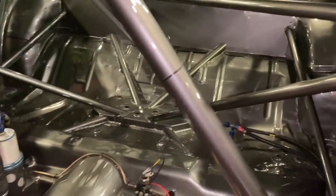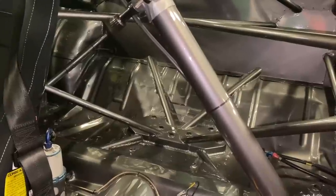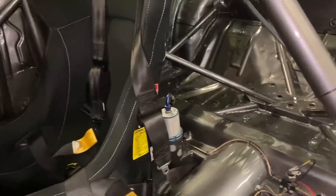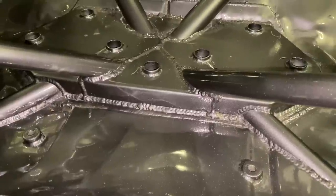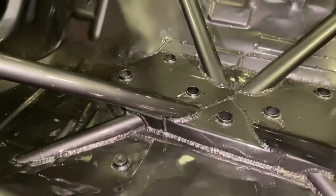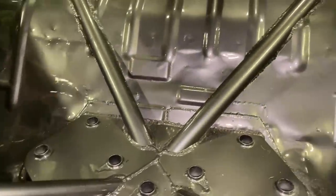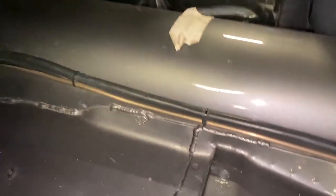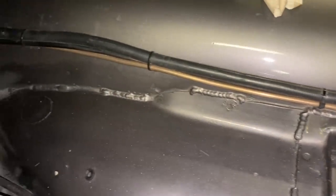What I do find interesting — the tubing is very thin, there's a lot of it, looks like probably 20mm tube. An interesting one that's come up in a lot of conversations recently: if you look, this is a genuine touring car, Vauxhall factory-built. And all the welds are spot welds — spot, spot, spot. It goes to show that will happily pass regulations. People do slag that off, but interesting for people to debate. As you can even see there — non-continuous runs, all spot welded.